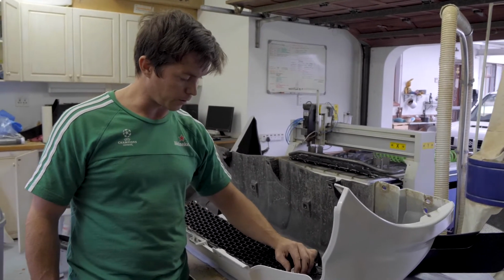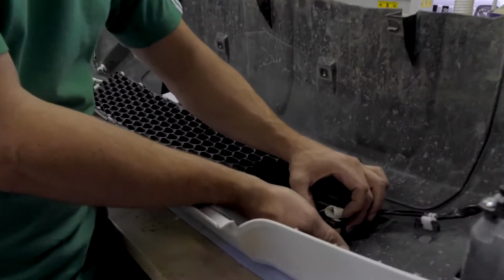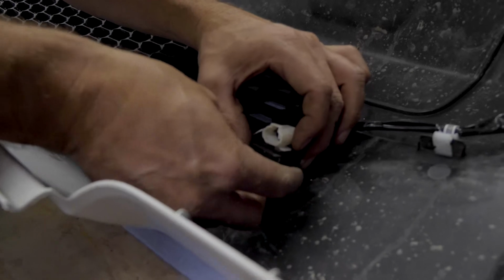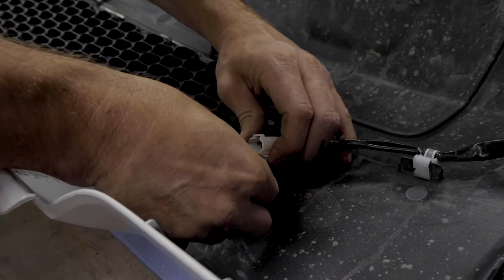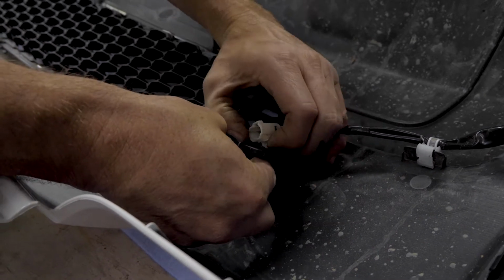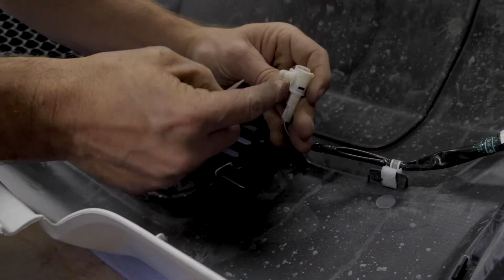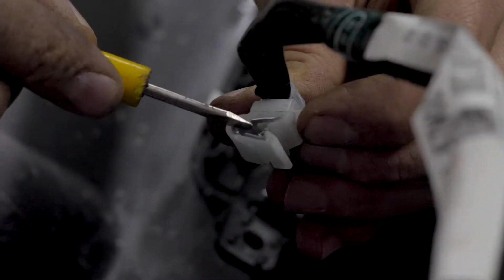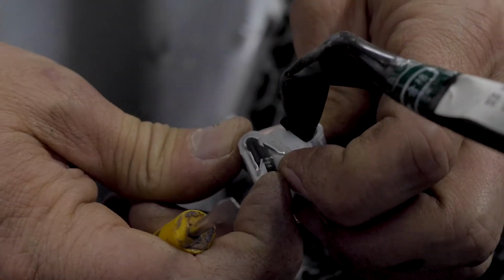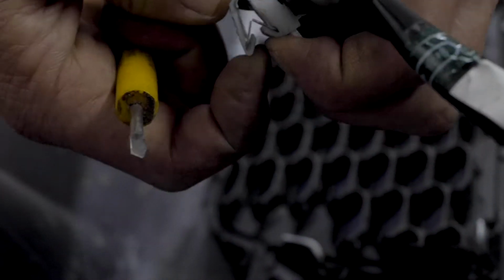This first clip here, which is your wire connection, it's got a little tab on the inside here, so if you come in with your screwdriver and just compress that tab on that side, the left and then the right of it, and this will allow you to pop it out. There's your 2 little connections. Okay, these clips have got little teeth that bite into the plastic, so you got to try open this away from the plastic and twist it out.